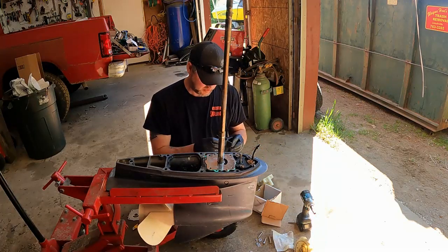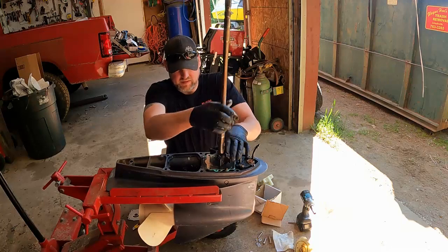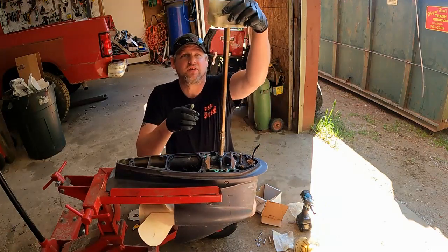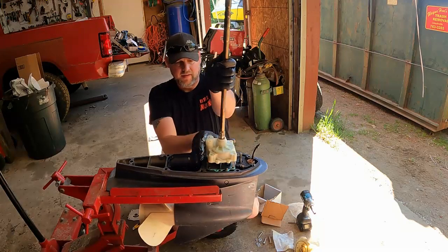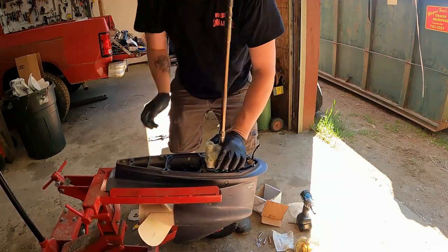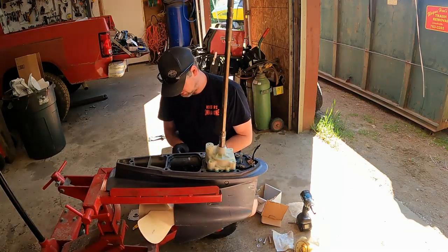Put your impeller on. It only goes one way because the keyway doesn't go all the way through. Just like that. A little grease doesn't hurt. This is where sometimes the impeller catches the O-ring. So, yeah. Let's see if I can, just like that, turn it so it pops on. See that, how it pops off? And you're on, just like that. New bolts with grease.